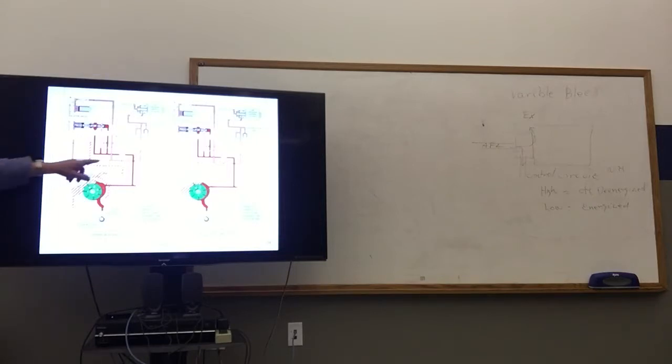Notice that our PCS line fluid goes up to our isolator valve. The isolator valve is used as an accumulator to dampen pressure pulses, giving us more precise control of pressure. They've done that on a lot of circuits in this transmission. When you had the spacer plate apart, you should have noticed a bunch of little accumulators in there — little spring-loaded pistons. Those were accumulators just to moderate or flatten out the pressure pulses from the pump, not accumulators in the sense of the 1-2-3-4 accumulator on the 4L60. Every time this pump is rotating, you've got seven vanes, and you create a pressure pulse seven times per revolution. These accumulators just dampen them out.